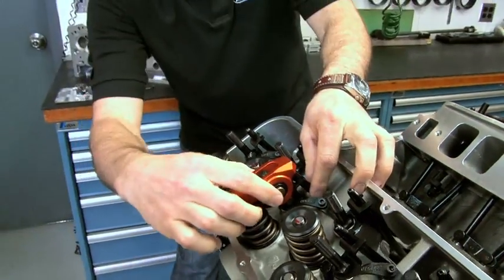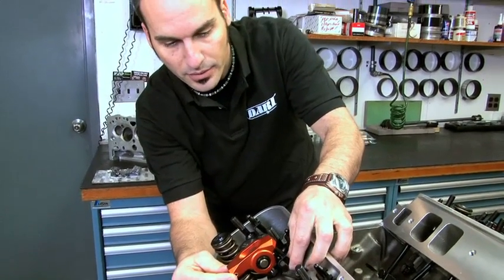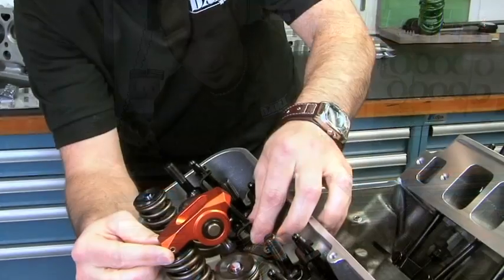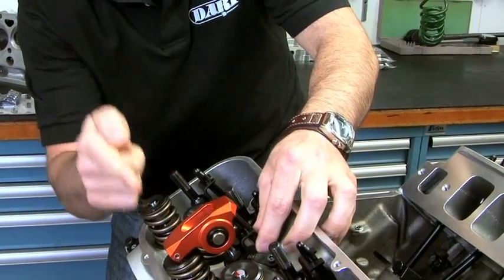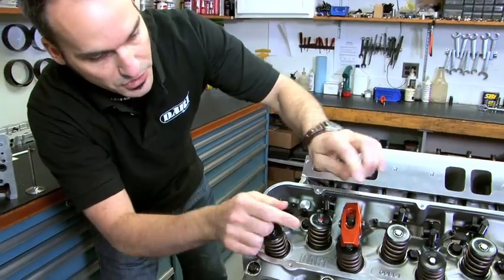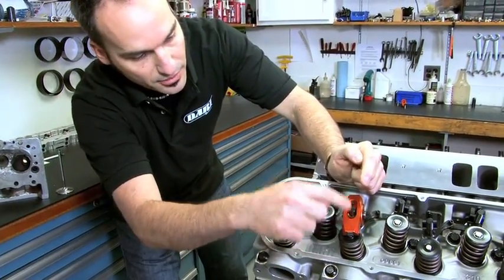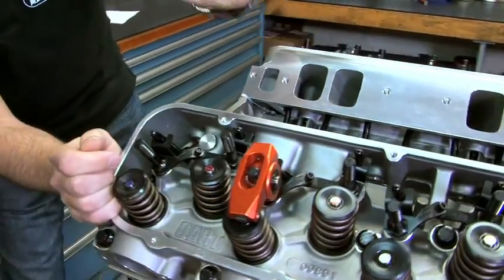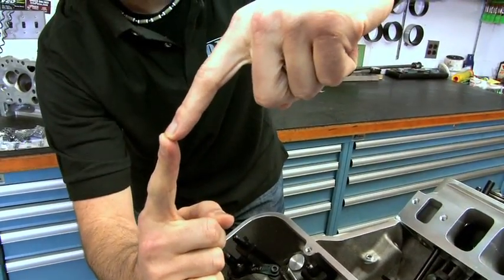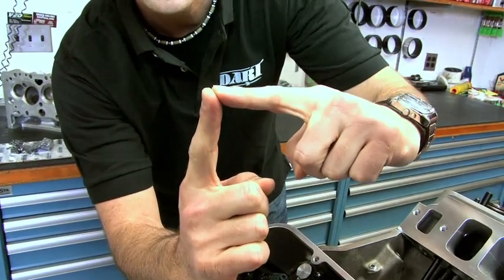The pivot point on the rocker arm is right here in the center. If I change my pushrod length, I'm effectively changing my pivot point and the angle that I'm creating with my valve tip. What I want to do is sweep through about 90 degrees between the arm pivot. That's going to make sure that I've got my angle to start with as I go through the motion, about the same angle at the full length of travel, and I come back again.